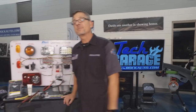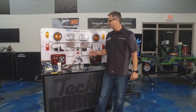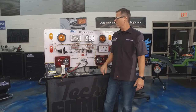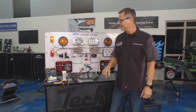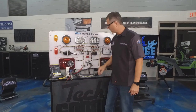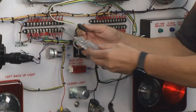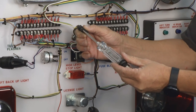We're making great progress on our Explorer and Dave's going to make it back to the trailer hitch in the rear in a little while. But before he does that, let's take a look at these wiring harnesses and trailer plugs because they're pretty universal and pretty simple. You can see I got one plugged into a board right here. What you would do is go to the back of your vehicle, find the harness that goes back to your tail lights, and trace down what circuit does what. I'm just going to turn on the right turn signal — on the harness, that's universally usually a green wire.